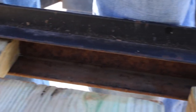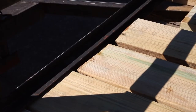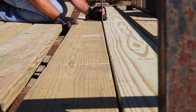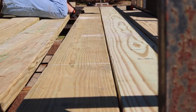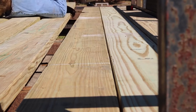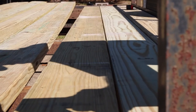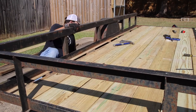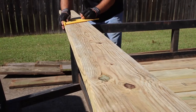I have to feed the board into a channel at the front of the trailer first before it will fit. Once I get the board into that channel it should drop down in place, and then I can start spacing out the boards accordingly — just as they were before, so there should be no issues. Once I get all this spaced out, I can start securing the boards to the angle iron. The center angle iron has holes down it so I can use screws through the holes and just pull the wood down to the angle iron. That's how the center of the boards are secured.